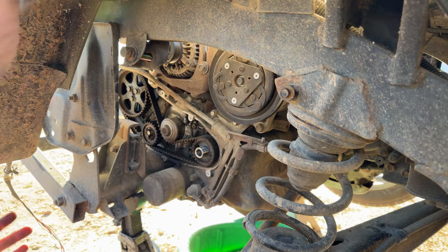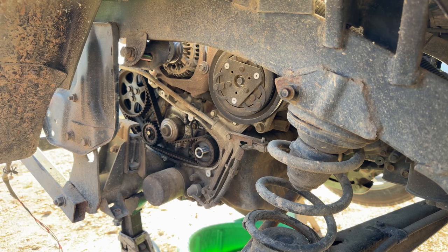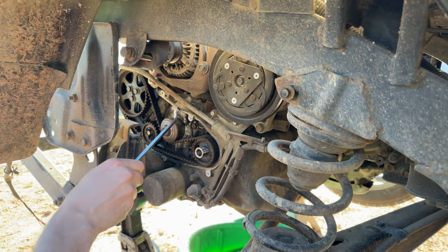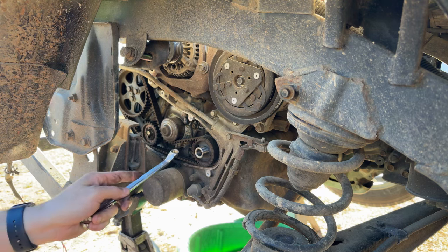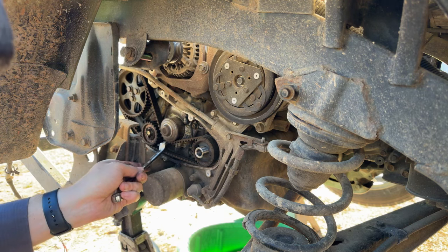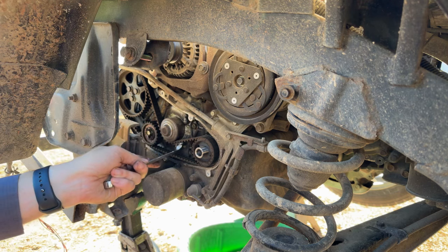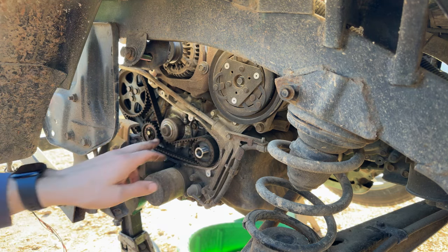So go ahead and loosen the tensioner, get the belt out of there, and get the old water pump off. They're always a pain to get off because there's two steel alignment dowels and they get bad about corroding. Aluminum block, aluminum water pump, but the dowels are steel and dissimilar metals. They'll seize up pretty good.